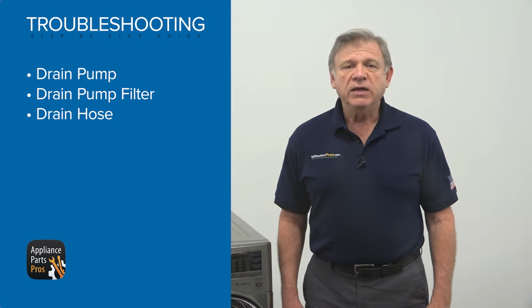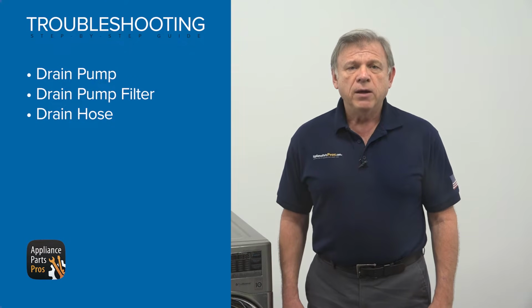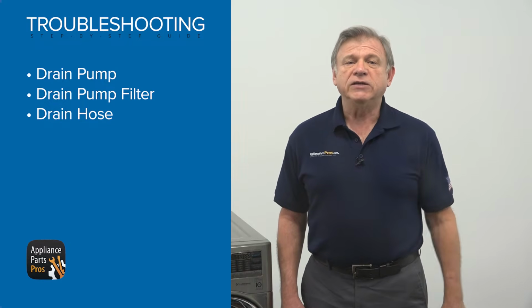Hello everybody, it's Simon. Today I'm going to help you tackle a common issue with LG washers, specifically when the washer stops mid-cycle with a pesky OE error code. This usually means that we need to take a look at the drain pump filter, and possibly a kinked drain hose. But don't worry, this is definitely something you can handle yourself.